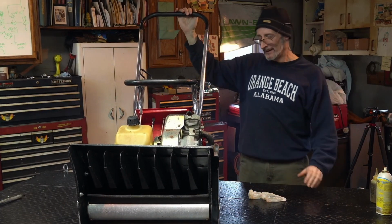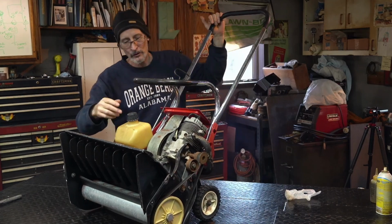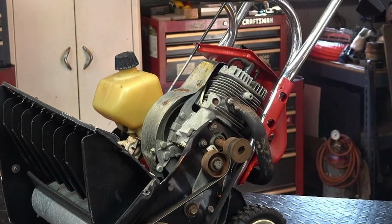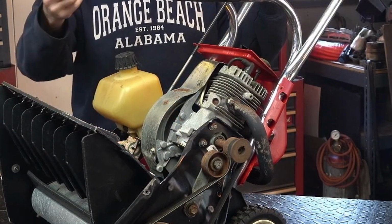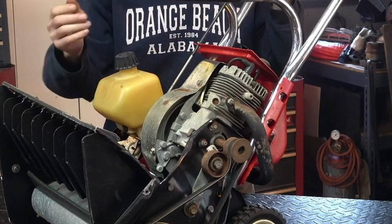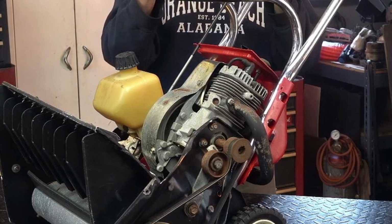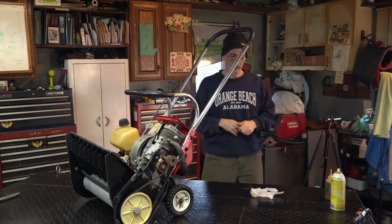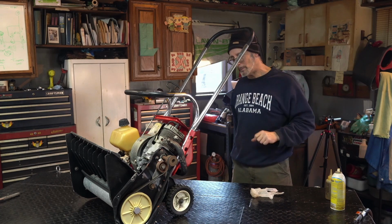All right. Let's get the rest of it off, because there's probably junk. It gets, the stuff, fellas, that gets on a two-stroke. You got your combustion chamber. Hold on, that stinks. Let me open the door. And then the crankcase has got to be sealed properly, because the air and fuel mixture with the oil comes in and lubricates the inside of the crankcase. If there's any bad gaskets or seals in here, it'll leak air and it will never run. It may run, but it may not run right. Also, the junk gets in there. Excess fuel and oil dries out and becomes very oily, pukes the charge. And the water will go in there. And it just makes a mess. And sometimes the only way to get it out is you gotta take the motor apart. That's the one bad side of these things.